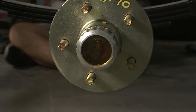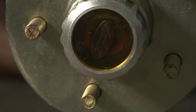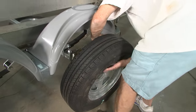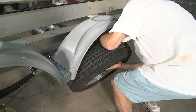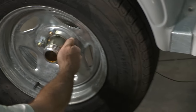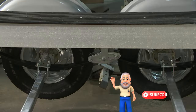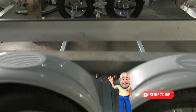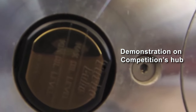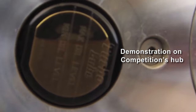What kind of oil are we talking about? It's a 90-weight gear oil — the same oil you use in your lower units, you can use in the hub. To monitor how much oil is in the hub, there's a sight glass on the end of the hub that gives you an indication of your oil levels and whether there's any water intrusion. Nothing has to be removed for you to get a quick glimpse — just a real quick check to confirm you're fine on oil. If you look in the sight glass and it's milky, that's an indication that you've got water intrusion.